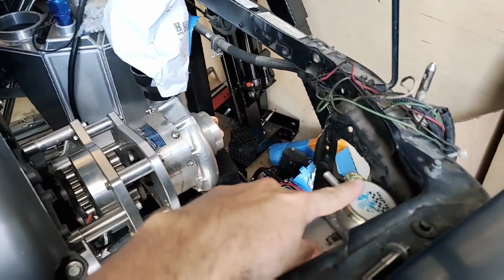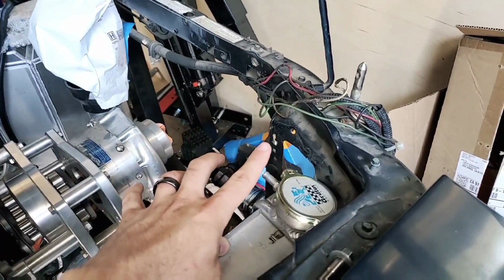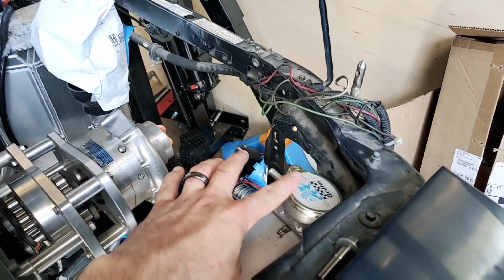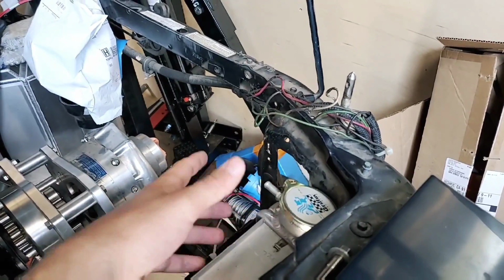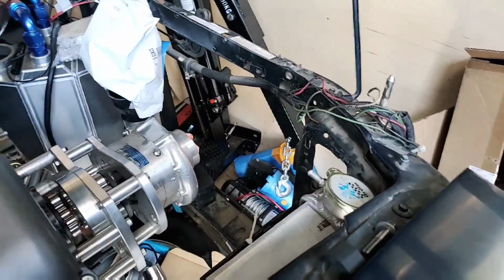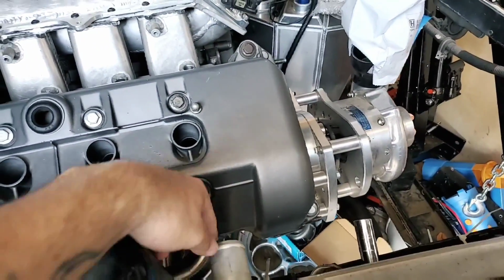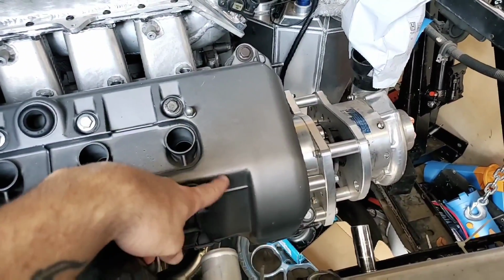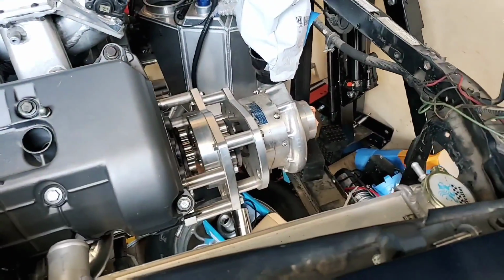I noticed that we can come up a little bit more with the radiator and still be fine on clearance. We want the radiator as high up as possible so that our fan does not hit our wheel. And also, the higher up this is on the radiator, the better, so that I can more easily fit a radiator hose in there. All right, let's get to it.